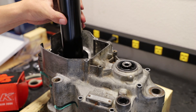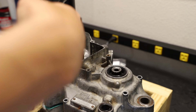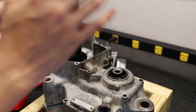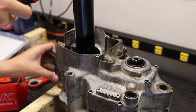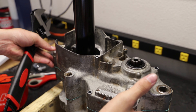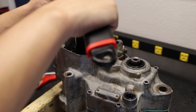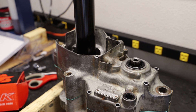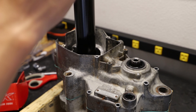The cases have completely joined together now. I know because when I'm turning the crank installer tool, it no longer wants to move easily — that's when you know you're good to go. The gasket is being somewhat compressed all the way around, so we are looking good.